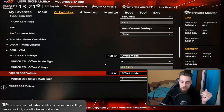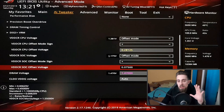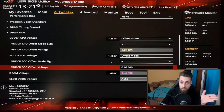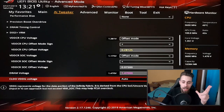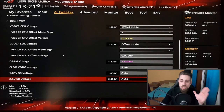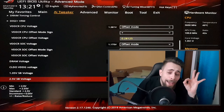For the SOC voltage, use the same offset method — plus sign and select the voltage. I advise between 1.10 and 1.17 V for the Ryzen 5 3600. You don't need to go higher unless you're pushing really high RAM speeds or overclocking the infinity fabric heavily, since the SOC voltage is mostly the voltage for the FCLK. For the DRAM voltage, I'm using 1.47 V.